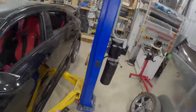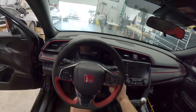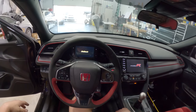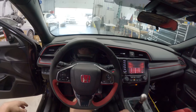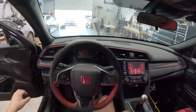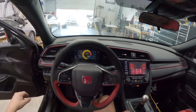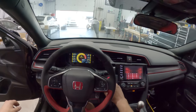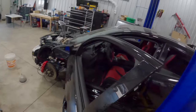It should be in the 14s while running. Ah, this is the coolest feeling in the world. She's running a little low on gas, but 13.6 volts while running — we're good to go there. All right, that was easy.